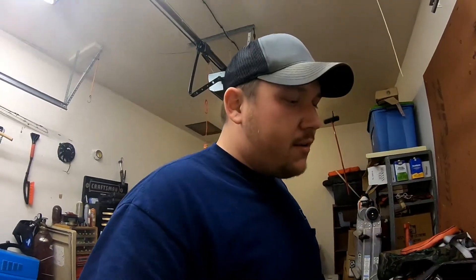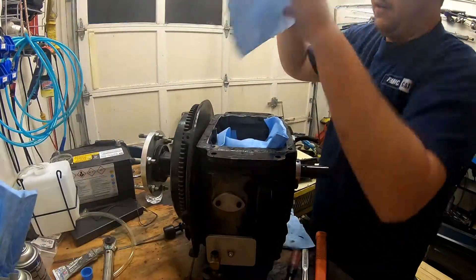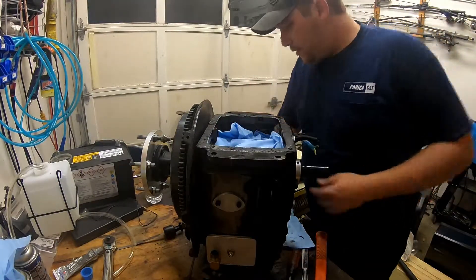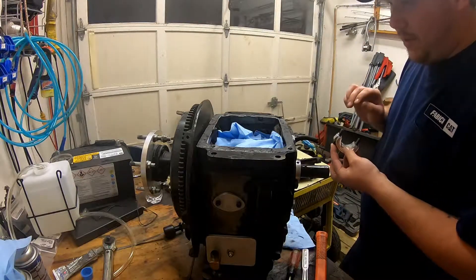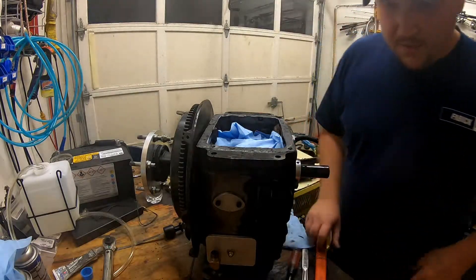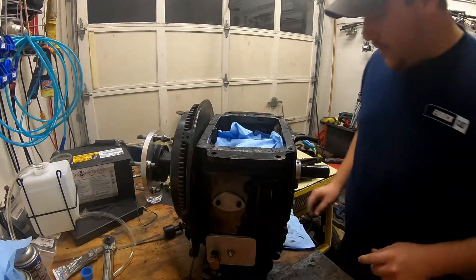This is a 12-horse block — it's not making anything crazy, but everything looks good in there. So we're just going to clean this up and then pull the head off to see what the cylinder walls look like real quick. I'm still pretty excited about this bearing only being a little wiped on the edges — means it's probably a little tight on the sides of the journal. But it's a 1970s model, never had anything done to it. Don't fix it if it ain't broke, right?